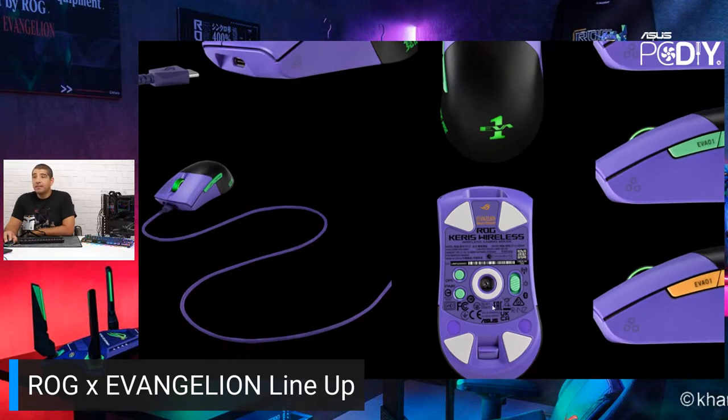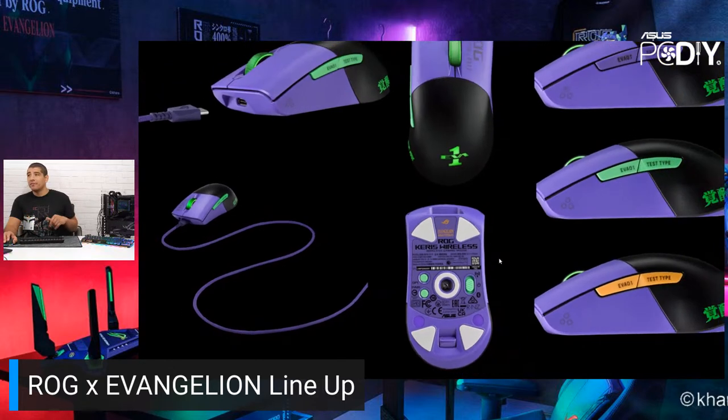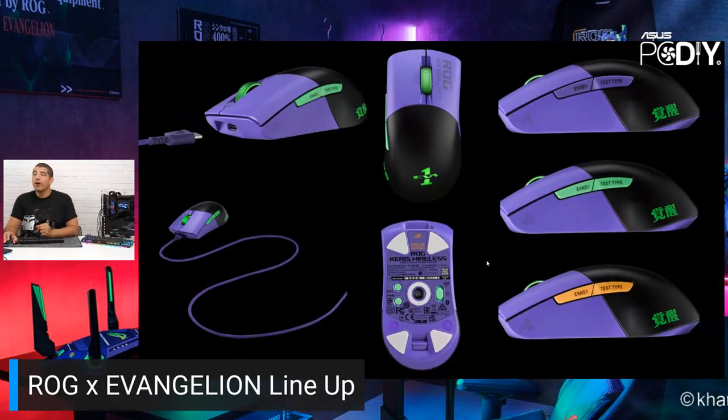100% PTFE feet come on here. These are our Omni feet. You actually get a second set of feet skates inside the box, which is great. It also comes with a second set of switches. And this mouse, just like all of our other mice, features our push fit socket design, so you can customize and replace the switches if you want to go with different ones. But it already comes with our premium ROG micro switches, which are rated for 70 million clicks. They also feature a gold-plated electro junction, which really helps mitigate oxidation, which can cause issues over time, like double-clicking and things like that.